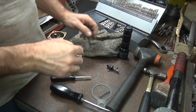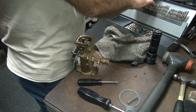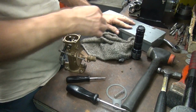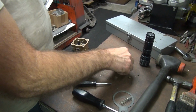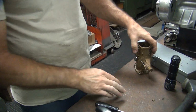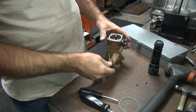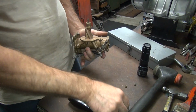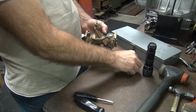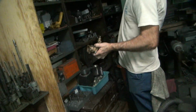I do. Okay, so now, instead of being about a quarter turn out on your carburetor, the old one, it'll be a bit bigger now. So it should be a turn, you said, right? It might be close to a turn now. A turn, or maybe a little more, a little less. Yeah, it doesn't really matter. I just want to be on a little bit. Okay, so now we have that all in there. Now hopefully this will take care of our problem. So then we'll see if that helps, and then we'll have to address the lack of fuel in the primes, huh?